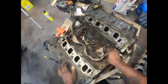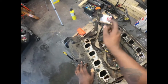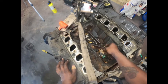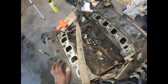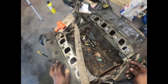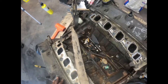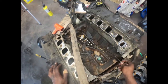But I broke down his motor because he's gonna be changing the intakes, changing the valve cover gaskets, changing the spark plugs, and it was full of mouse droppings, as you can see. And they actually chewed up, I think that would be the knock sensor. They chewed through the wiring on the knock sensor. So we just have to take the one off his car. The cigarette butts in here, mouse droppings. Just take the one off of his and replace that.